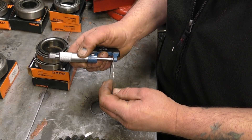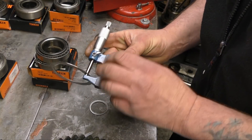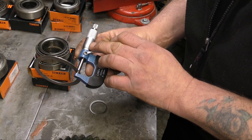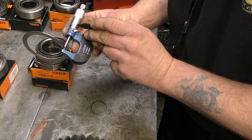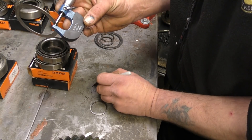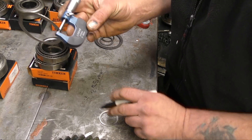This one is for the pinion height — I will be explaining this because it's very, very important. We need to know what we've got and what we're dealing with. When we've fitted the bearings, we might have to use a different shim. So I've got that and I'll just write that down — which is 2.85 millimetres.